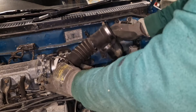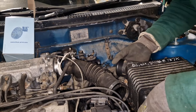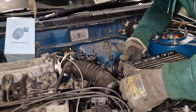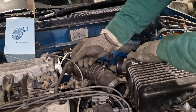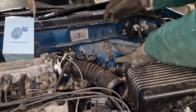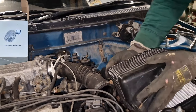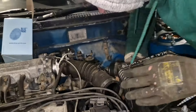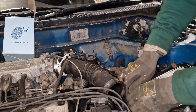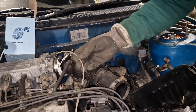Be the lord, that is a makeshift job. I wouldn't mind, lads — the more you look at it, the more you realize why it wasn't running right. Because it has these little pipes that are, I'm assuming — because they are coming out of the intake — that's vacuum. There is definitely an issue. I'll have to replace them.